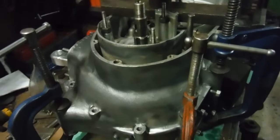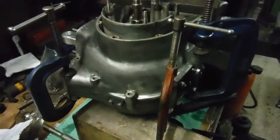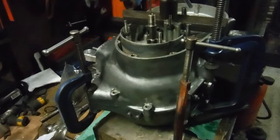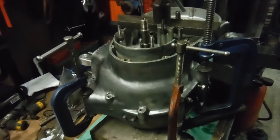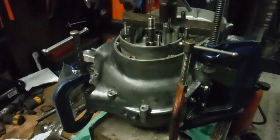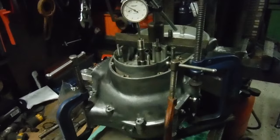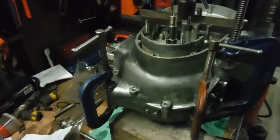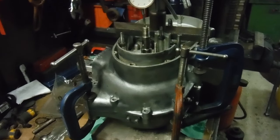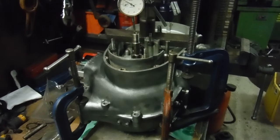That's the end of my working day, but tomorrow I'll be taking this apart, getting the G-cramps off and unbolting it. I'll be applying gasket sealant, not forgetting the little rotary breather disc that's driven off the end of the camshaft. I'll oil everything up and the cases can go back together and be properly bolted. We're going to have a bottom end pretty much ready to go and a gearbox that we know is in good shape. So finally we've got some real worthwhile progress.